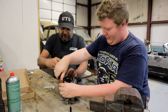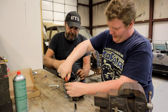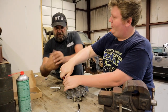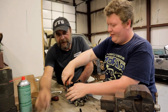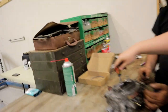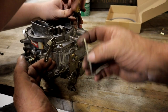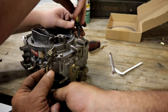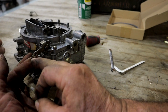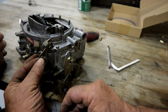We got to put our accelerator pump link on there and get these tightened down — don't gorilla them. When we install this link, we're going to put it in the middle hole. The end hole is for a very mild shot; this other end hole is for a very aggressive shot. Just to start our tuning, we'll put it in the middle and go from there.